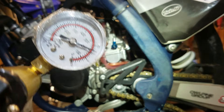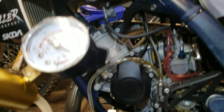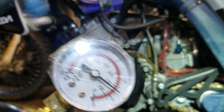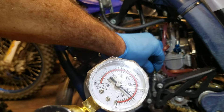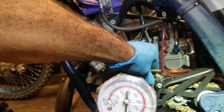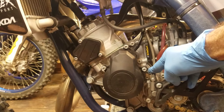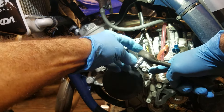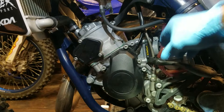While you do this, keep track up top — make sure you don't suck your reservoir dry. If you suck it dry you'll have to start all over. While it's doing that, if you have a six millimeter wrench you can tighten it up. If you don't, what I do is pull it off, stick my finger over it like this, grab my ratchet, place it on top.